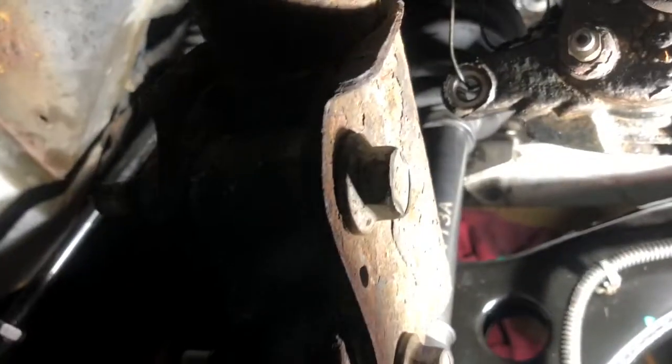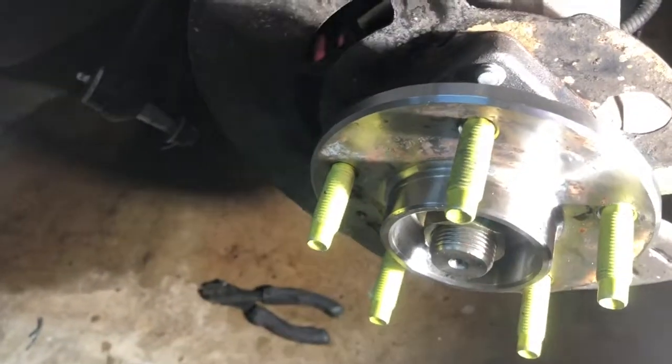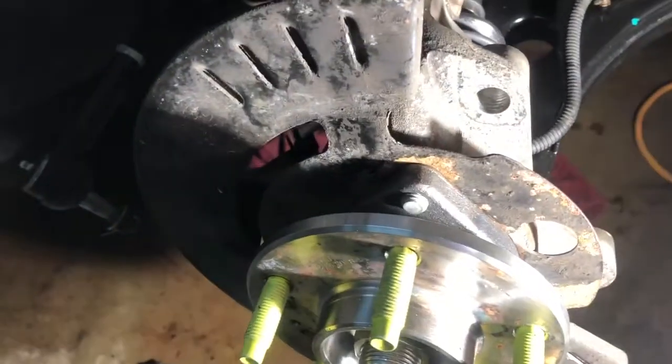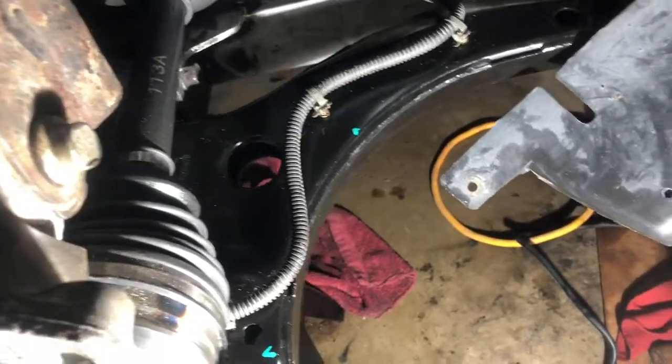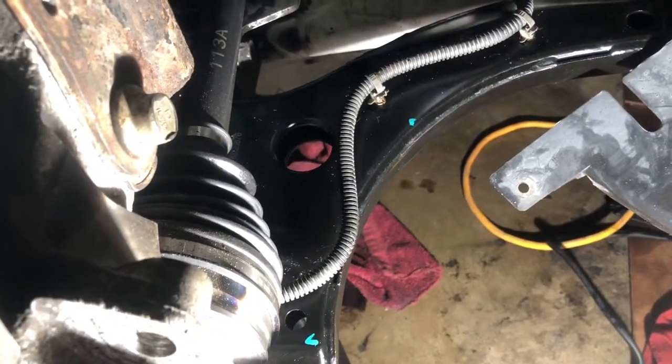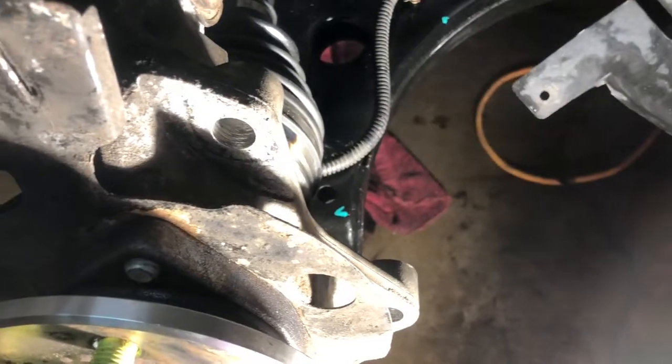I know you're probably getting tired of all these updates, but here's a little progress: we've got the axle installed — hopefully not leaking. I haven't added transmission fluid yet but we'll see. The hub and steering knuckle are back on, the new lower control arm is in, and the ball joint is tightened up. Still got to do the tie rod and button up all the rest of this stuff. Right now I've got to secure the ABS wire because those little clips like to break off, so I'm going to do the double tie-wrap thing, then get everything torqued down and put back together.